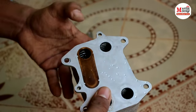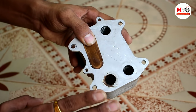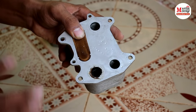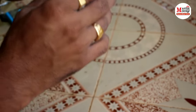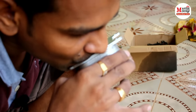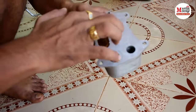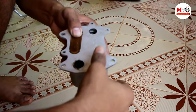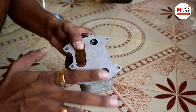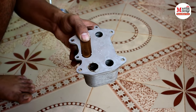To test it, we first clean the oil cooler with shampoo and water. Then we apply a vacuum from the mouth of the cooler to check for leaks. If it holds vacuum it is good; if not, it is leaking. This is leaking slightly from the back water side — it is a very small leak, but this is the method to find it.